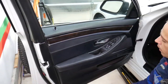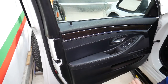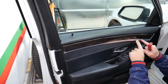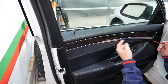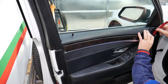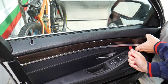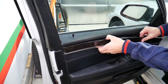We'll be removing the door panel because we'll be replacing that door handle — that's a weak spot on BMWs. On this 5 Series there are a few special clips: one slides this way, and there's a metal one that holds everything in place. On the bottom you have the ambient lighting — if you pry it that way you will break it, so don't do that. Come in at a corner and start pulling it out. There's one metal clip on the bottom — press up and it comes out.